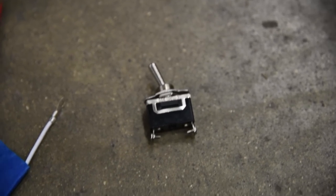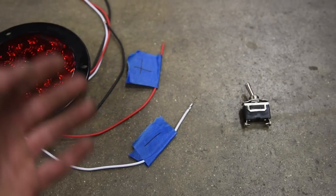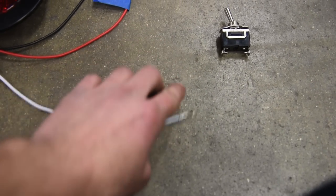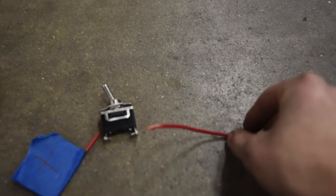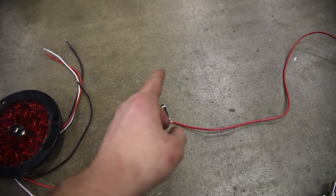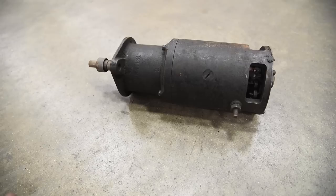When wiring up these switches, it's actually very easy — you've just got two different terminals. Your ground wire goes to earth, don't even worry about that. All we need to worry about is the positive wire. Put one end of the positive wire on the switch terminal, and then the other end goes to the battery itself. The moment you flip that switch, you run current from the battery into the light, and when you shut it off it breaks the connection and the light does not turn on.